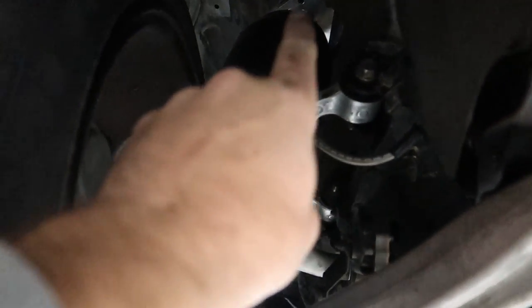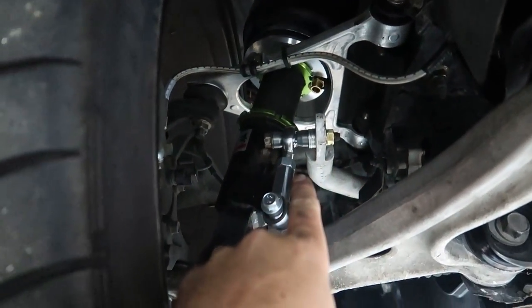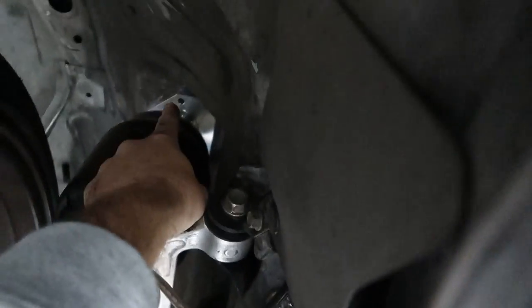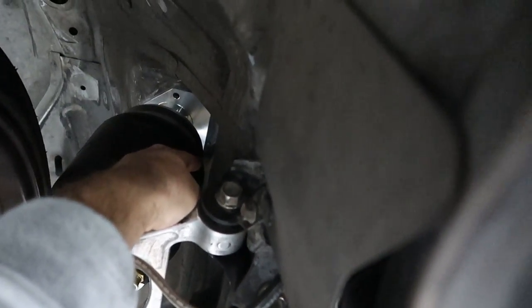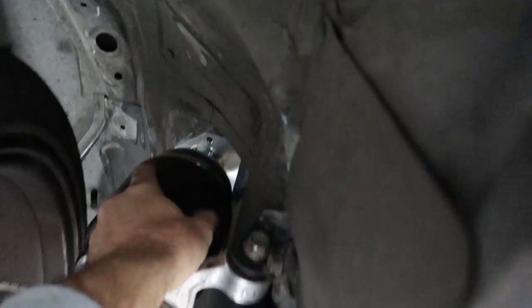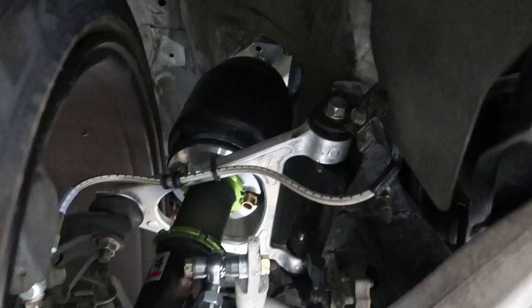We've got some new top hats. This is a prototype setup from UAS, but the clearance issue has been resolved. With the factory top hats, we were having some clearance issues against the frame rails. They whipped us up some new upper hats that offset the strut, which created the clearance we needed. Thank you UAS for being creative and milling us out custom parts at the last minute — it's always great to have partners that do custom work so we can get over hurdles without a bunch of challenges.